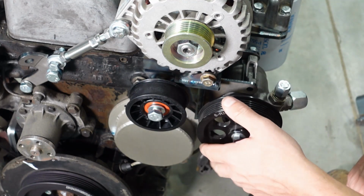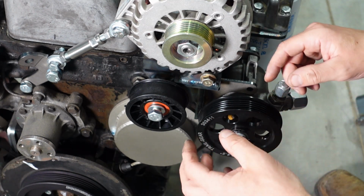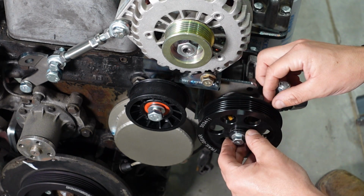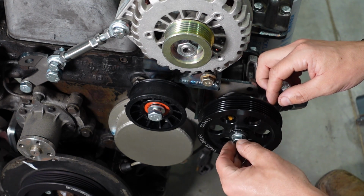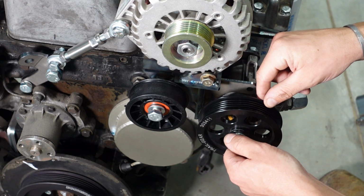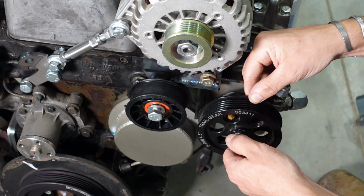As you'll notice here on this pulley, we do have the serpentine set up, so I'll just go ahead and mention it here. On a power steering pulley, you line it up with the other pulleys. There's no dead stop for this pulley. So when you're using your pulley installation tool, you're actually eyeballing this to make sure your pulley's lined up with all your other pulleys. That's going to be a press fit, but as a safety precaution, we want to use a bolt with thread locker to make sure if this pulley would wear out on the power steering pump shaft, it still couldn't come off. So I got a flanged head bolt with some Loctite, and I tighten that in just until it's snug. You don't want to torque this, because to torque this would mean that you're pushing the pulley further onto the shaft. So you just snug this up to the pulley, let that Loctite dry, and it's done.